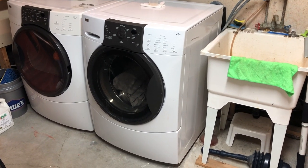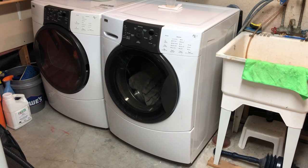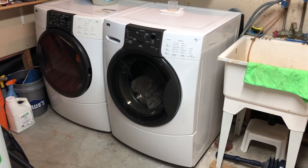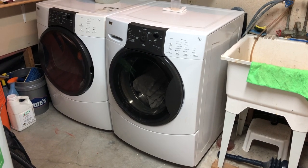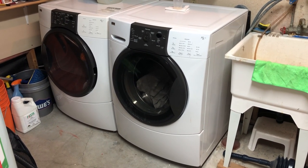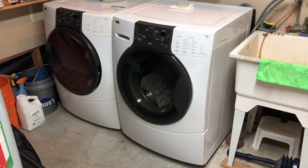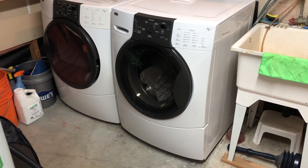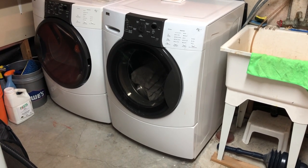If you've tuned into this video, you're probably having the same problem I did with your Kenmore Elite HE3, HE2, or some similar model, or any other washing machine where you're finding your clothes sitting in a puddle of water not having drained or rinsed, and/or you're getting an F02, F01, F25, or any other F code pertaining to an issue with the pump — also referred to as a SUDS error code. You might find online that it directs you immediately to a new pump, but don't do that. Repairmen are very expensive, and the pumps aren't cheap and can be hard to find online.